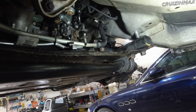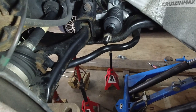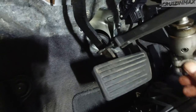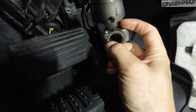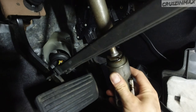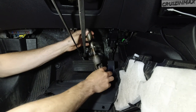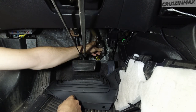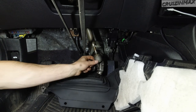All I've got left is to tighten those big bolts up, then the final two — one on each side — and then the outer tie rods. For the yellow alignment piece, position it so the notch goes in here; just eyeball it, it should be fine. You don't need to worry about positioning the steering shaft — this just moves up and down, so move it all the way up and simply lower it and attach it to the splines. That's the last thing to do.